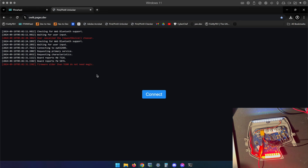At this point you can enter factory mode, level your rails if you have aftermarket rails, pair the BMS, pair a new controller — all the things I mentioned earlier. If you want to update back to a newer firmware version, you can do that after leveling your rails and you will maintain the level. If you want to update to 5200 and you're not already there and think you might want to downgrade in the future, please send me an email. If you upgrade using the Future Motion app or OneWheel app, you will not be able to downgrade without disassembling your board and using an ST link to restore from a backup — and for the Pint X, that is not easy to do.